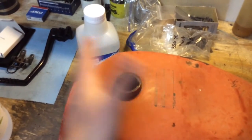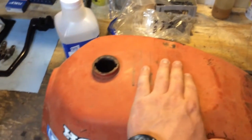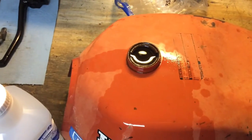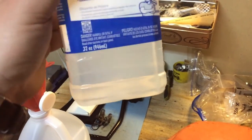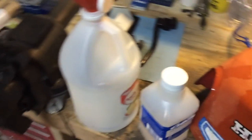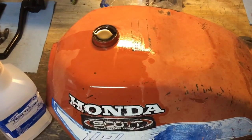I know before I've always put the cap on, but this one didn't come with a cap, so I'll probably just throw something down there — I don't know if it makes a difference with oxygen getting in or whatever, but that's what I've had the best luck with. Once you have a system that works, don't change it. This thing shouldn't turn out too bad with a bunch of pressure washing when I'm done. So she's full, full, full — I didn't overfill it, though I spilled some before I started filling it because I forgot to use the funnel. Two gallons plus a 32-ounce of paint thinner — 946 milliliters — definitely enough for most 185S gas tanks.